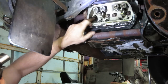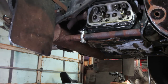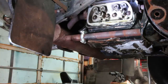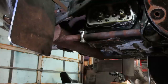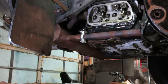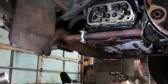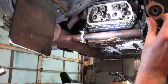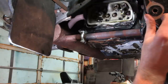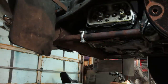That one was still good. Usually if they turn, they'll turn like a good half turn — sometimes a full turn when they're bad. A lot of times that's either the stud pulling out of the motor, or the motor got real hot and everything kind of stretched and cooled off from overheating. So that's not going to be our issue, but I wanted to check it anyway. I'm going to do the same to the other side, then get back and adjust the valves.